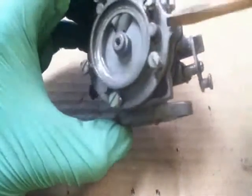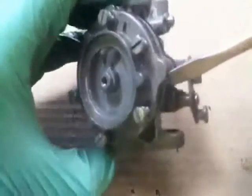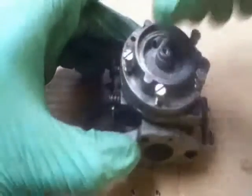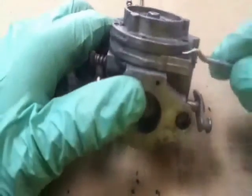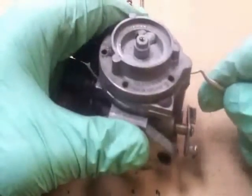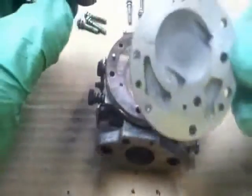On the top you'll see this impression here, and that goes all the way down to the carb body. So that's the way it's got to go back on. If you look right around, that's the only place where the impression comes out, and as long as it marries up with that when we come to put it back on, that's great. So let's be careful how we take this off now, because there are diaphragms in between there.